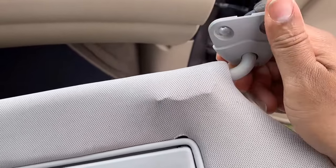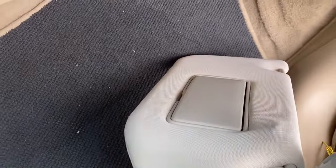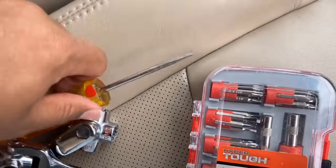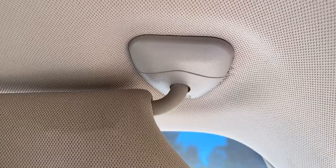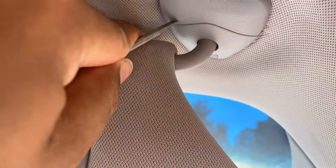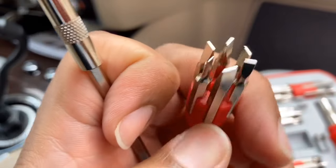In this video we'll be replacing a torn visor. For this you will need your new part, a 3/32 socket, and a screwdriver. Now you may have to get a professional tool depending on how tight the plate for your sun visor is. Most videos say it's a piece of cake — just pop it out — but I couldn't get this thing out. You may be able to get it with your screwdriver, but be careful because if it doesn't pop out you'll scratch the upholstery.